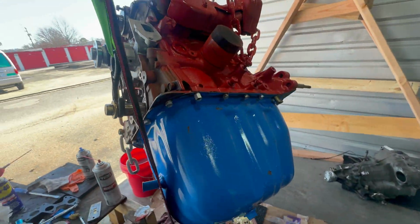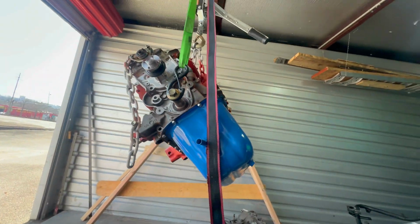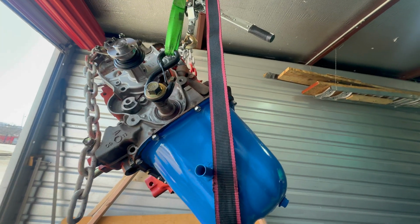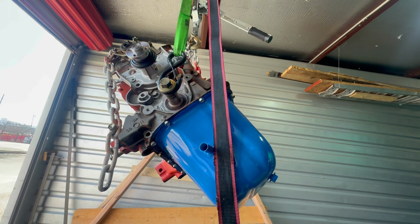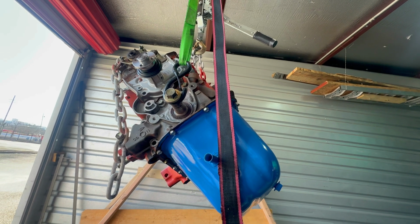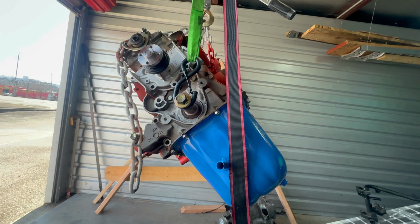All right, I have the oil pan on, finger tight on the retaining fasteners. The RTV that I'm using says wait 1 hour for curing before torquing down. Finger tight only until then, so that's what I'm doing. Got about half an hour left on that.